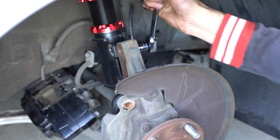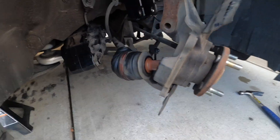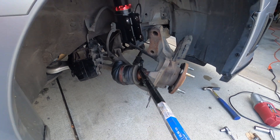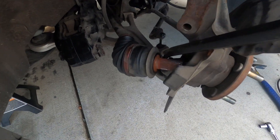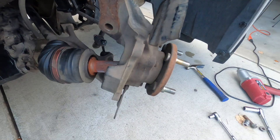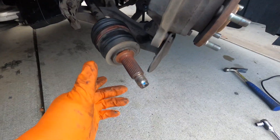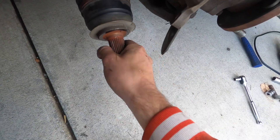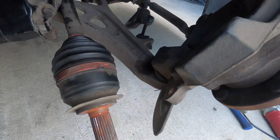Unbolt your little ABS sensor back here. It's a bit tough to get the axle out of the hub on this side, so I like to turn the wheel all the way to the left and then you can kind of pry it out. As you can see, almost got it all the way out — just got to drop it down now. We're free on this side, good to go. The slit is underneath it right now but we'll be able to see that in a second.